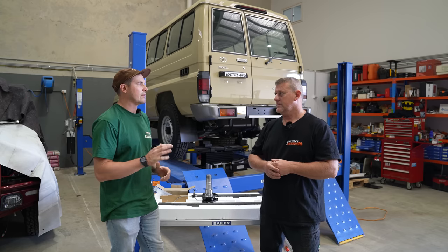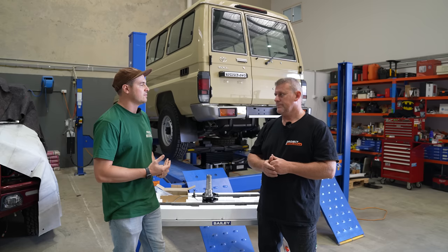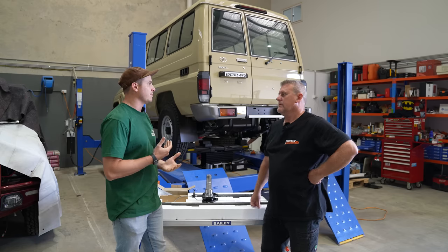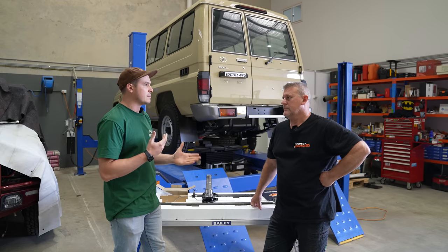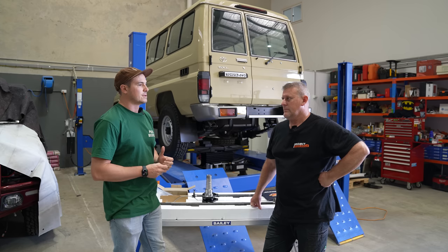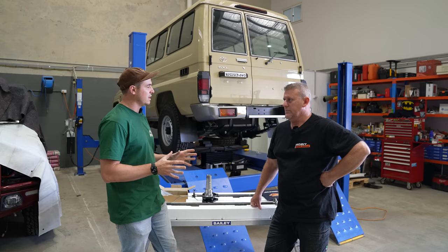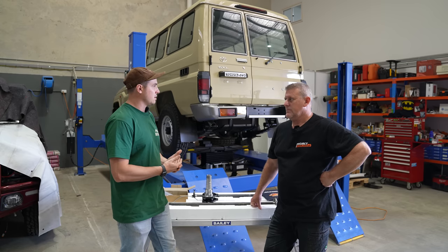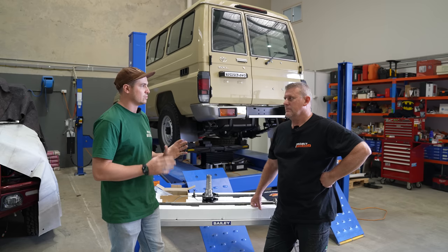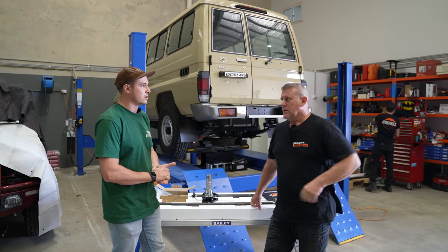If you're getting 79s and you're sort of going around that 4 ton mark, that's when you would probably want to start considering replacing the diff. But for me personally, I'm going to try and keep the Troopy around 3.5 — in between 3.5 and 3.6 loaded with people in it. Because I don't want another 4 ton Troopy rolling around Australia. I want to try and keep it fairly light, keep it neat. This GVM upgrade I'm going to be going for is the 3780, which I think is a good range for the Troopy.